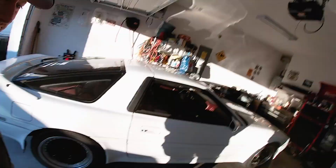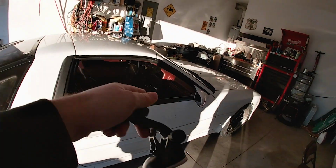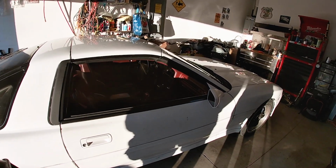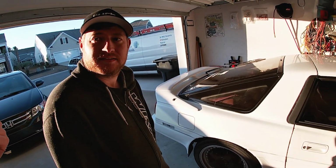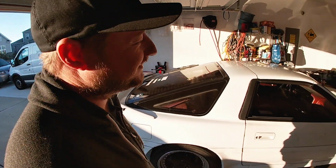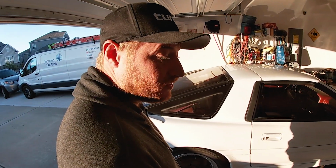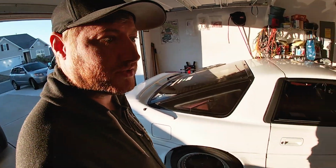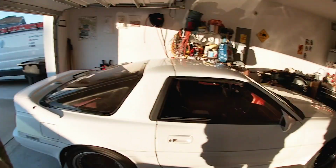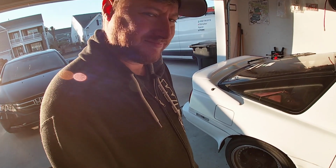All right, so it's been a week since we messed with this. I mean, you just watched it, but a little recap for us. The kilometers weren't matching up with the speedometer, so the RSM wasn't working. But it's fixed now. What was it? The connector I used didn't cut the speed sensor wire on the ECU, and I had all the settings wrong. Well, just the tire settings, but yeah, they were wrong. So that's all fixed. He took it for a spin last night to make sure it worked, so we were prepared for this morning. As much as we can be.